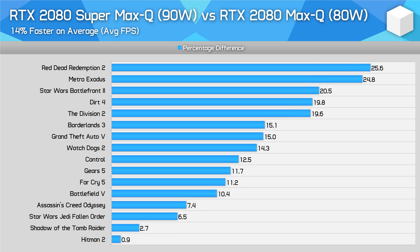Finally, I have a comparison between the RTX 2080 Super Max-Q running at 90 watts and the RTX 2080 Max-Q running at 80 watts. With the added 10 watts of power and increased efficiency, the Super variant ends up 14% faster. Based on this figure, I'd expect high single-digit gains where both GPUs are running at 90 watts, which does make the Super model faster than what came before, but again, this is an incremental upgrade.